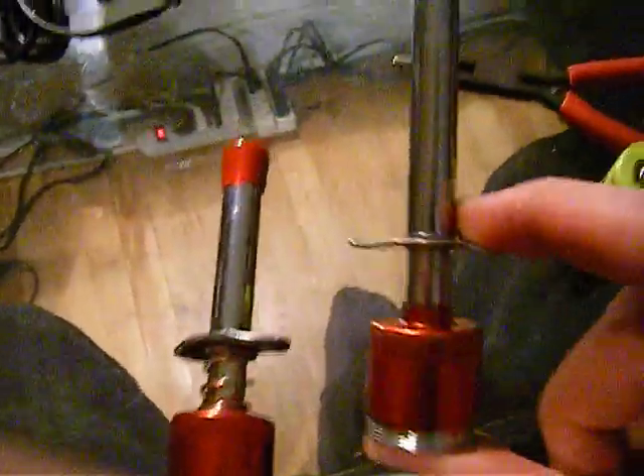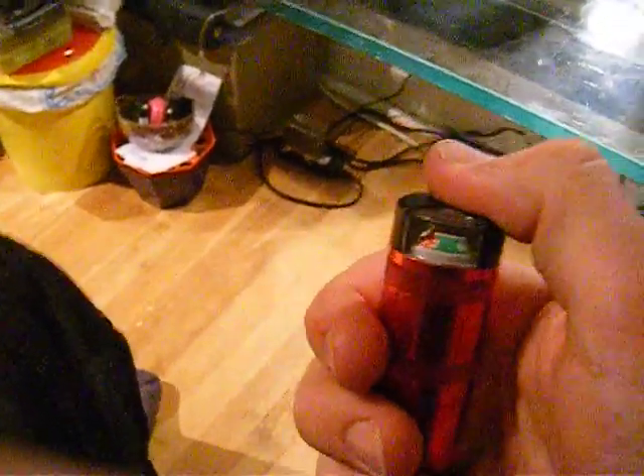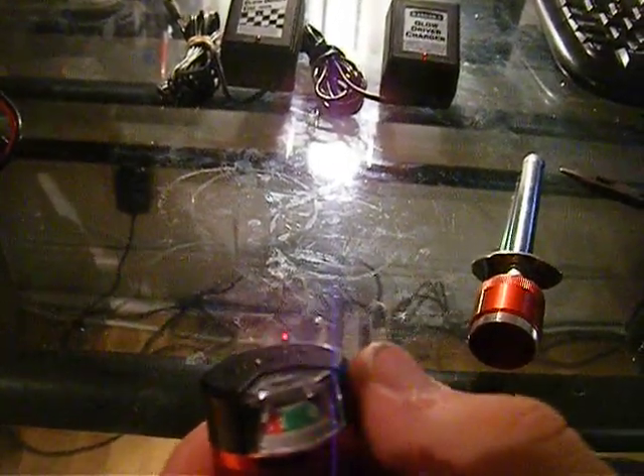The difference between these two is length. The one I bought for my truck was a long reach because I never knew what body I was going to put on. This one's a short reach since it's just fitting into the truck. Another neat feature is a gauge on top — it gives you a rough idea whether this thing is starting your glow plug or even the size of your glow plug. If your glow plug is not good and it's open, it will not show a reading. If it's completely shorted, when you push it down you'll hear the needle click all the way to the other side. If it's good, it will sit between the green and the red.